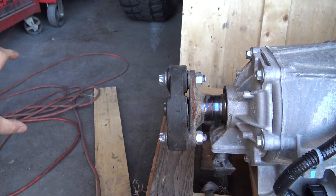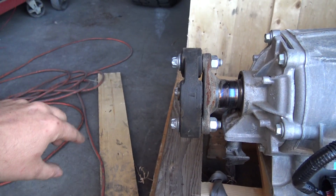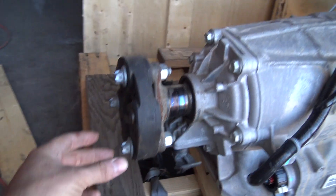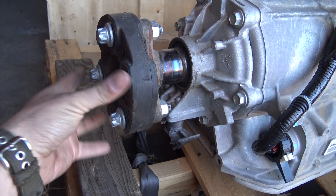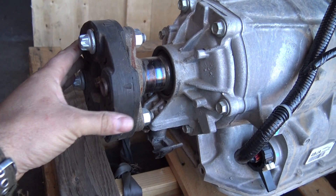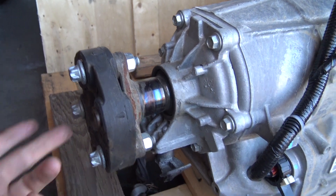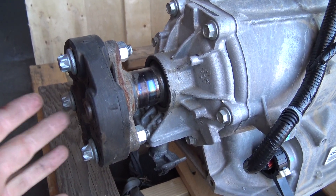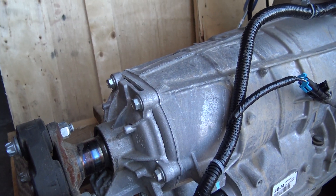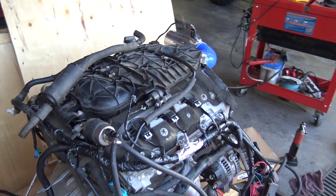Because of the fixed yoke, you have to get a driveshaft that's pretty much the same as a 4x4 front driveshaft that slides in itself back and forth. There will be an extra cost in getting that made, plus there's an adapter that gets rid of this rubber bushing — which is kind of unfortunate because I'd like to keep that, it just makes things smoother — but there's a billet adapter that changes this to a 1350-style U-joint. That's probably $180 to $200 just for that adapter, plus the cost of the driveshaft. I'll talk to Adam here in town — Adam's Driveshaft — since we get driveshafts from them every week they usually hook us up pretty good on our own projects.